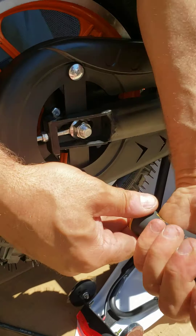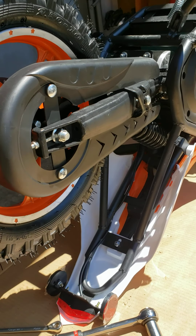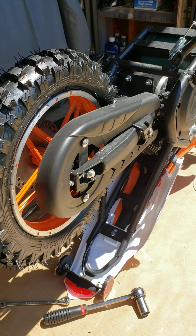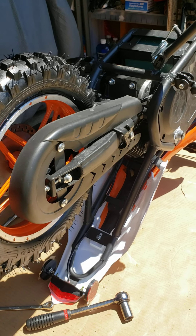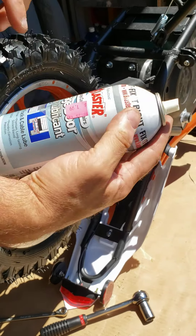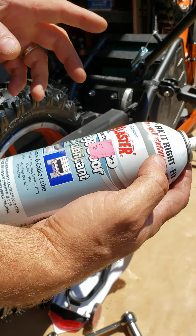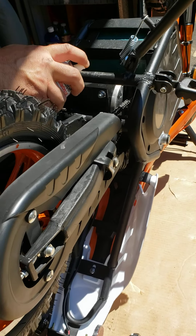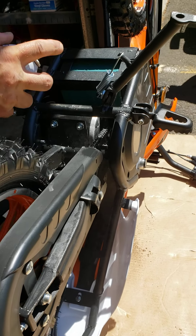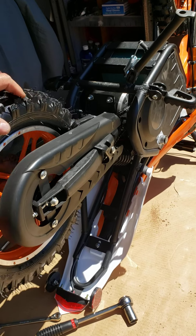Make sure your inner tire has proper pressure — it should be between 12 and 15 psi. For the rear wheel, even 20 psi is okay, that's the maximum before the inner tube could be over-inflated. Also, don't forget to lubricate your chain periodically with any garage door spray or lubricant you have at home, to prevent the chain from getting too dry and breaking.